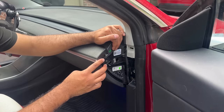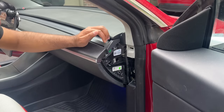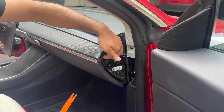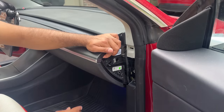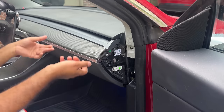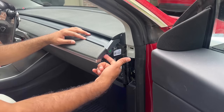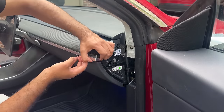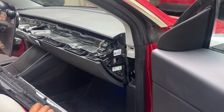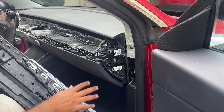Now this dash is free to be removed, but if you have a Model 3 or Y built in Austin recently or Shanghai, you might have another torx screw somewhere here — kind of hidden. Take a look and if you find one, remove that torx screw. On older Fremont-built cars I haven't seen one. Then simply pop this out. If you try to push it and it's stubborn, then you have something in there. For me, having removed this so many times, it just pops out. There are pins that this is connected to.